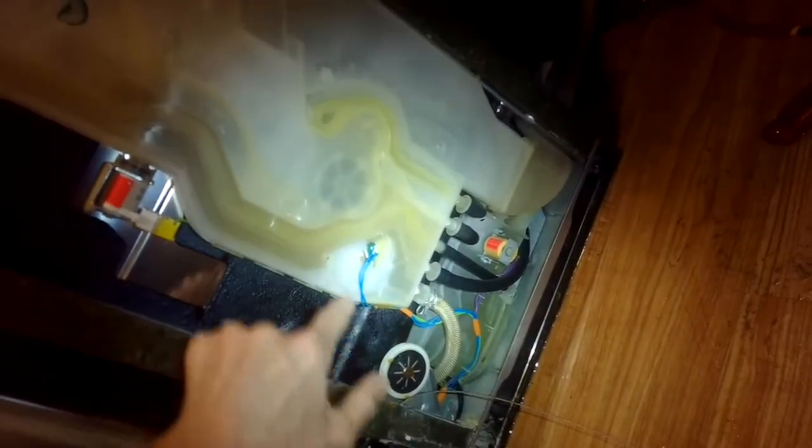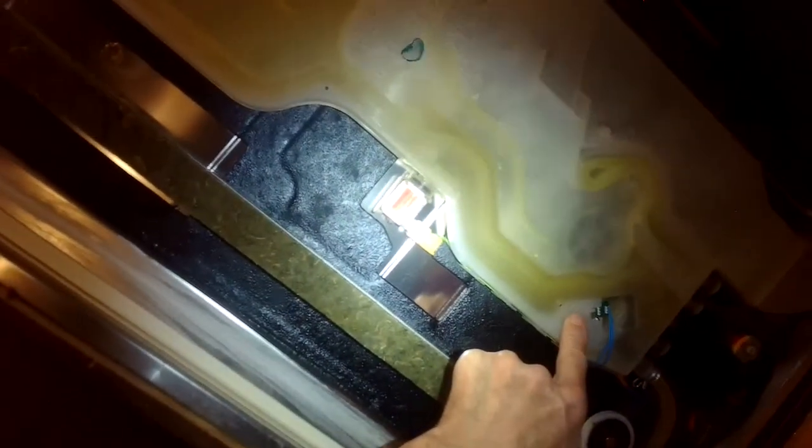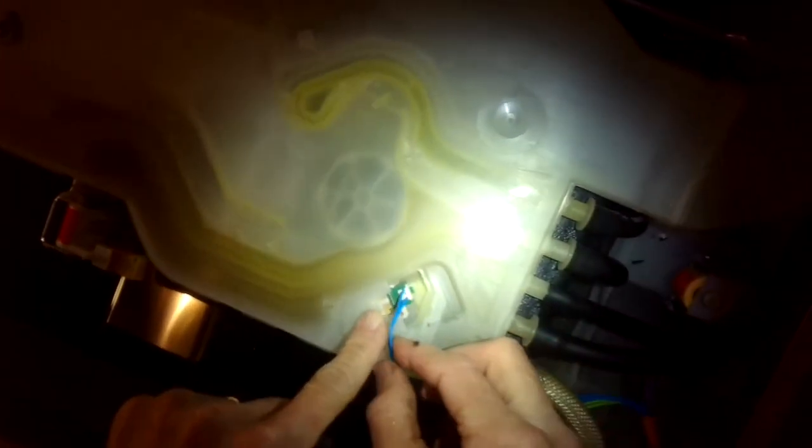On the Incognito model, with the right panel off, this is where the water comes into the dishwasher. The water comes in from the fill tube through this line and goes past a little wheel that spins — this is called the flow meter. A lot of times with Miele dishwashers when they're having trouble, this is a common part that may be having difficulty. You can just replace this, or if you can get it moving it will often fix many of the problems.